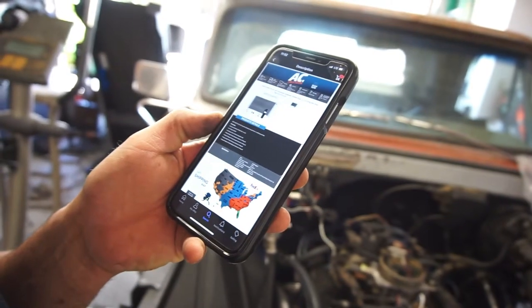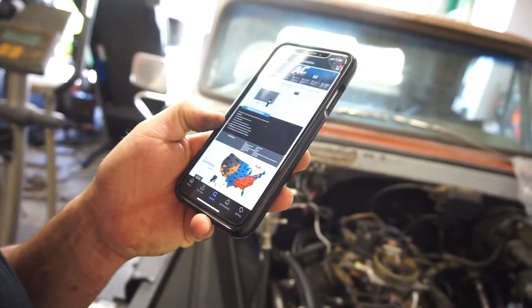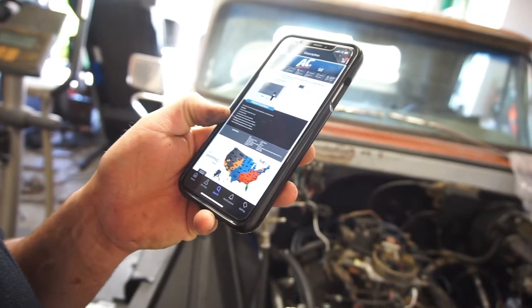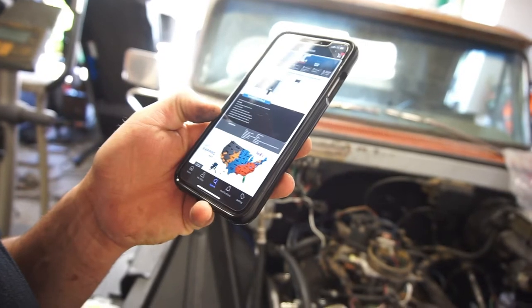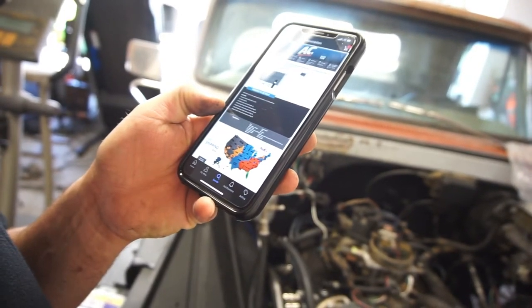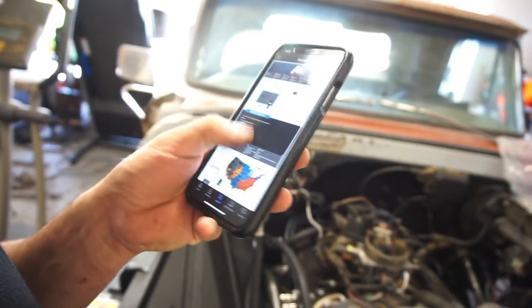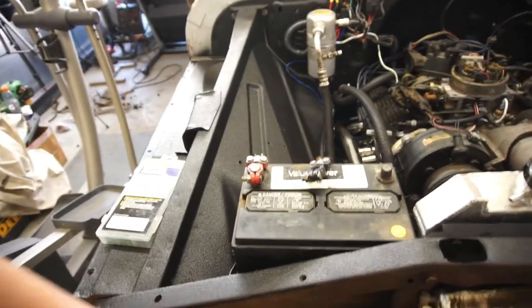So you get a kit that includes a universal condenser, parallel flow, one low pressure switch, AC receiver dryer, one fitting straight female, aluminum O-ring, one fitting 90 degree, one fitting straight female, one 90 degree. So basically, I'm thinking how it works is it just maybe presses in there. I don't know. You guys tell me what you think.